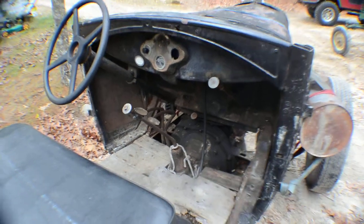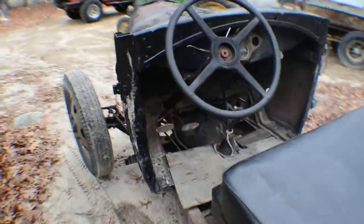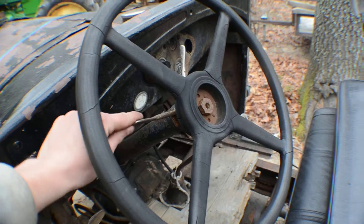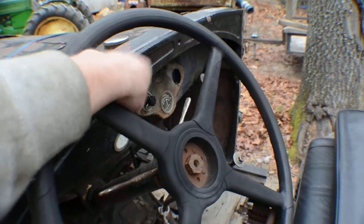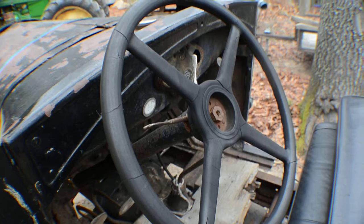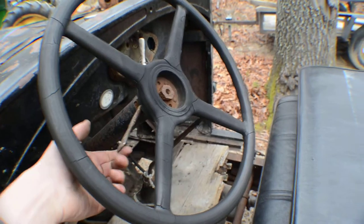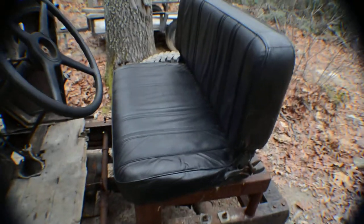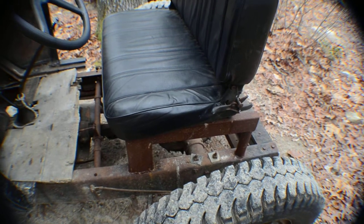Just a peek inside the cab — what's left of the cab. What's cool about these is this is your timing retard and advance, and this is a hand throttle so you can set your throttle and just chug along, then set it back to idle. You start it up fully retarded, then bring it down after it fires up. It's got a CJ backseat from Best Top with custom rusty brackets.